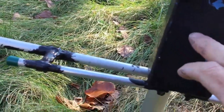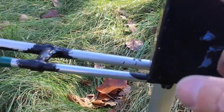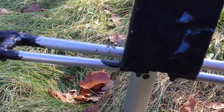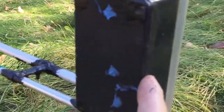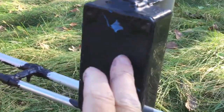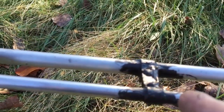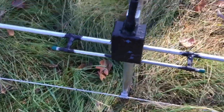What I did: take this cover off and dump liquid tape on the inside around all the holes. It may take a couple of days — just dab it on, let it dry, dab it on, let it dry. Then when you put the seal on, put liquid tape around the whole thing, put the cover on, let it dry, then go around it again on the outside. You've got to cover these screw holes too, otherwise water will get right through. I liquid-taped this on both antennas — just some pointers.